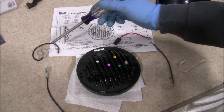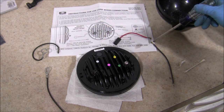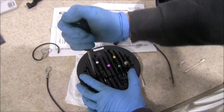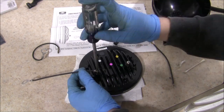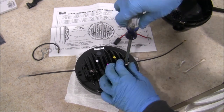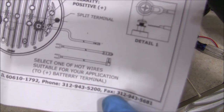Installing the LED lamp kit is pretty easy. The unit comes with some wires and a diagram, and you use the new wires that come with the kit in place of the old ones. The diagram says you should put the split terminals between the screw head and the lock washer before tightening. I had trouble getting one of the screws to open up enough to allow this, and at first I did it wrong — but I went back and fixed that one with some fiddling.